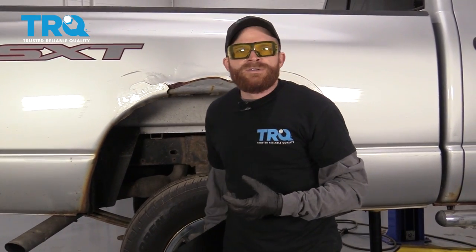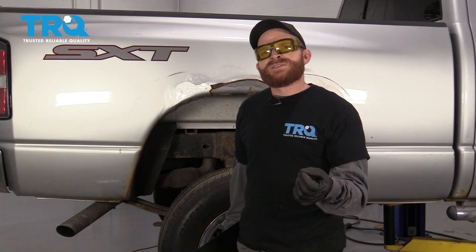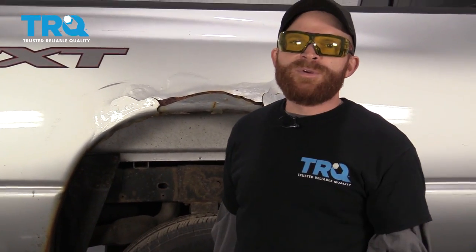And then of course, what we're gonna do is we're gonna cut it and we're gonna tack weld it in. After that, what you're gonna wanna do is make your own decisions on whether you wanna continue with the welding or if of course you want to try to fill it, sand it, and then paint it on your own. Like I said, we're gonna be welding in this video, so make sure you disconnect your negative battery terminal.